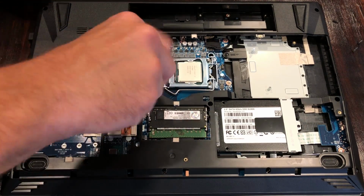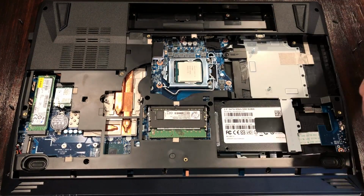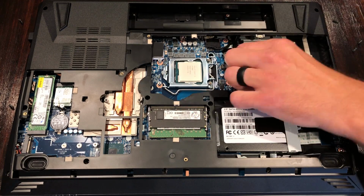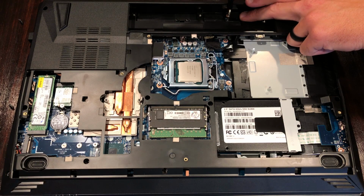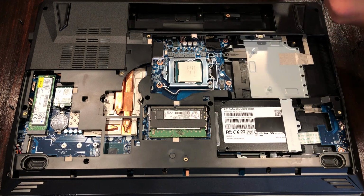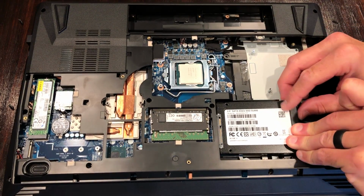The rest of the black plastic bottom panel skeletal assembly needs to be removed. All of the black screws here are the same length, and just completely remove every single one. The 4 silver screws that were underneath our battery, left to right, number 1, 2, 3, and 4. Number 3 right here that I am removing, you do not need to remove. Just a heads up. If you happen to have a 2.5-inch drive, please remove that now.